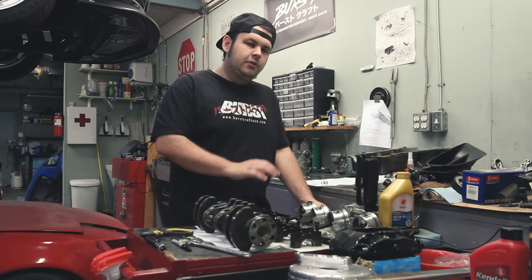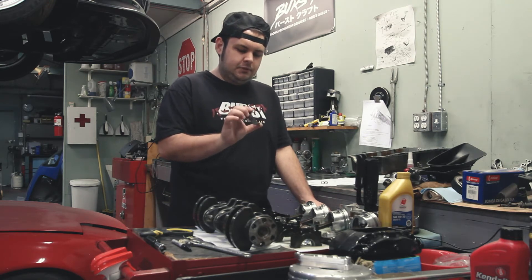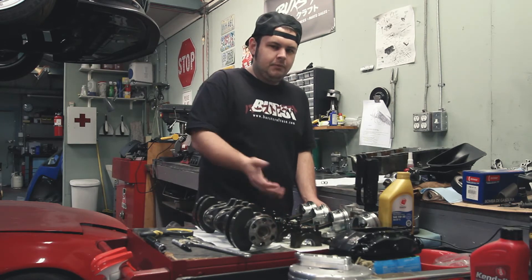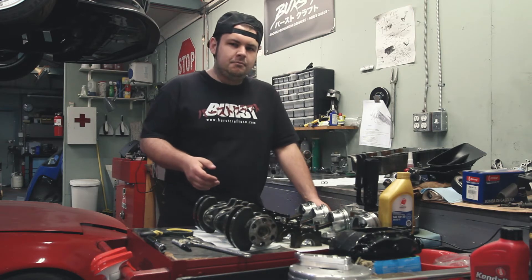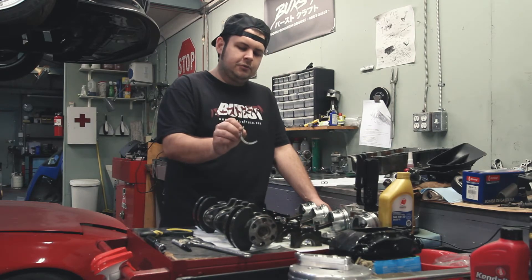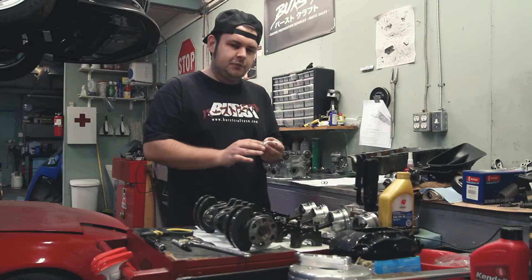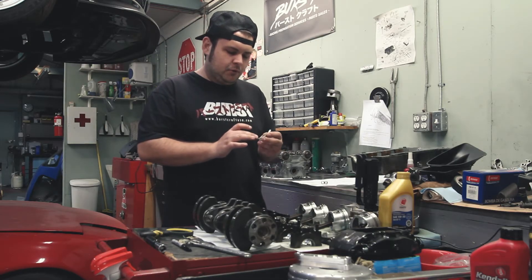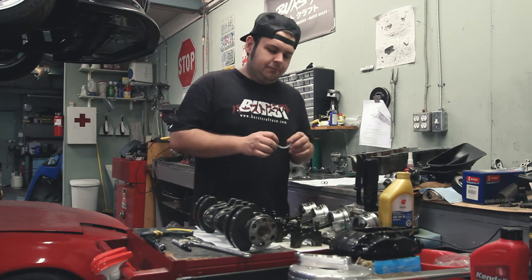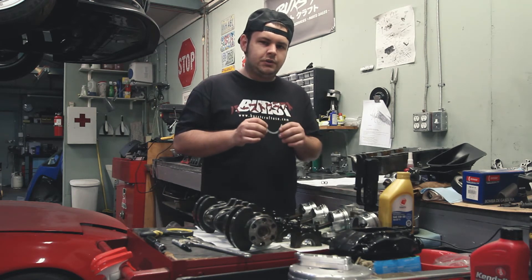We're going to be covering main and rod bearings. These bearing styles in particular are called Babbitt bearings — I just refer to them as rod and main bearings because you only get them in one form. The style doesn't necessarily matter because they all look the same. And here you'll see our thrust washers or thrust bearings. These have a machined surface on one side, and the other side is a little more coarse with cutouts for oil passages. Placement of these is fairly critical — they're easy to install but also easy to mess up in terms of orientation.